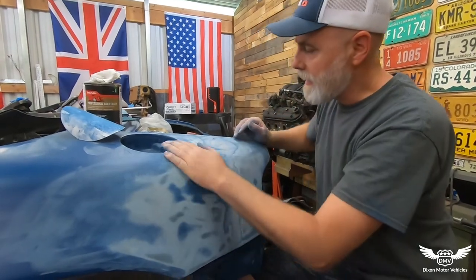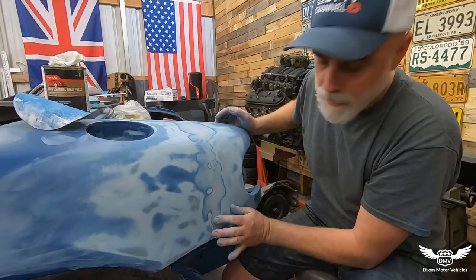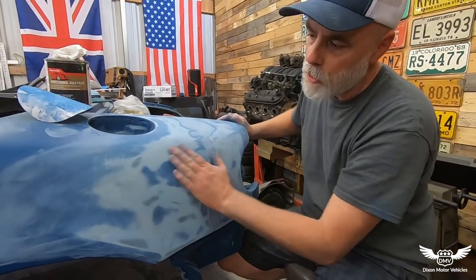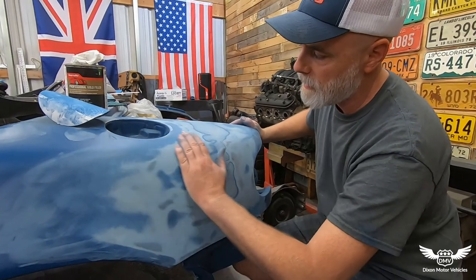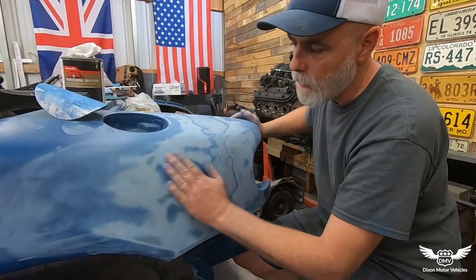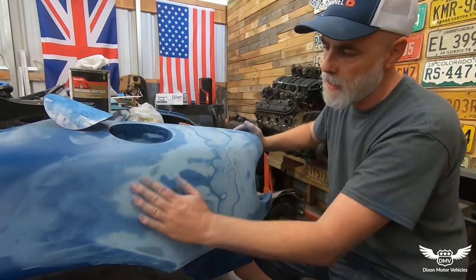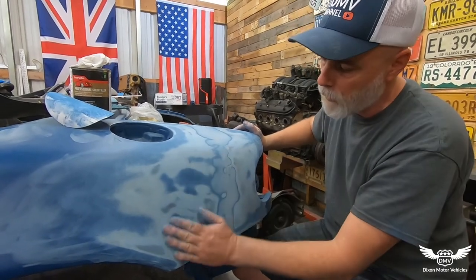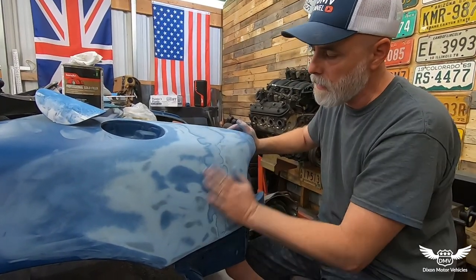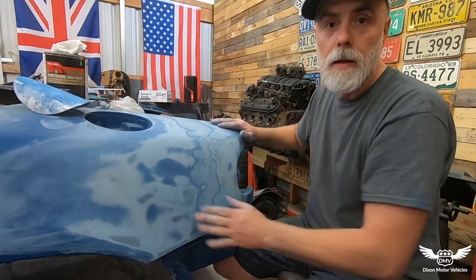Okay, I just blocked it out with 150, and you can see my original seam where I grafted this on is right there. This whole side really needs skim. There's a low spot. So what you do when it's like this is you essentially skim the whole thing with body filler, rough it in while it's a little bit tacky and gooey, then block sand it out as it hardens. It'll probably take two or three times before we get this right. But when we're done I don't think you're going to be able to tell that it had a new quarter panel piece — just a little section welded on. Let's get to it.